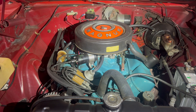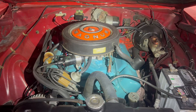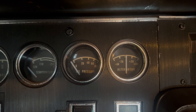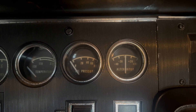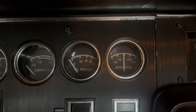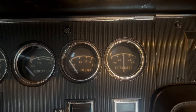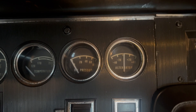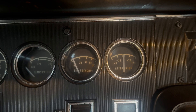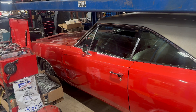I installed a shunt wire in the same manner on my 1968 Charger a couple years ago, with one important exception — there's no fusible link over there, because I like to live dangerously obviously. I've found the resulting reading on the alternator gauge in that car to have a little bit less action than the one in this Challenger. That's what the gauge reads at a higher rev right after starting, when the alternator is putting out the most juice. So again, it reduces the efficacy of the gauge, but it does still do something. That was a dead cold start after shutting this thing off about a week ago — impressive!